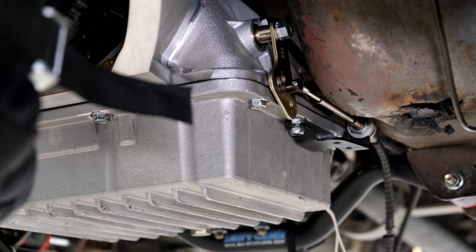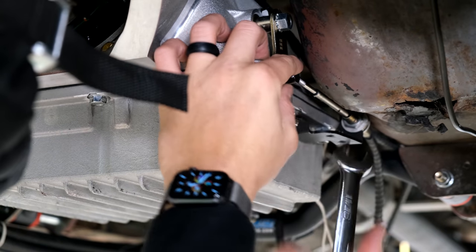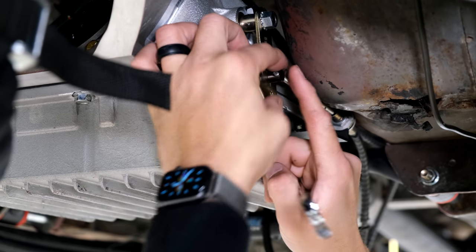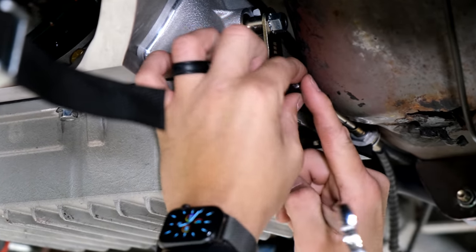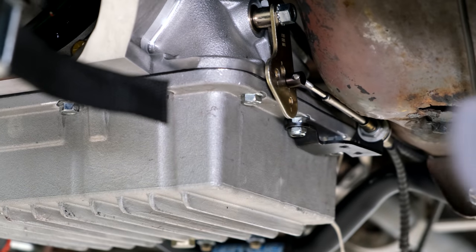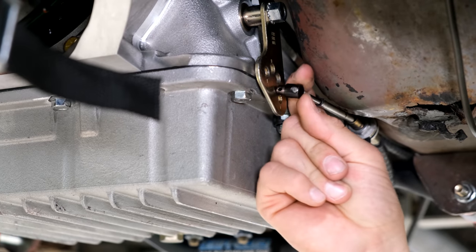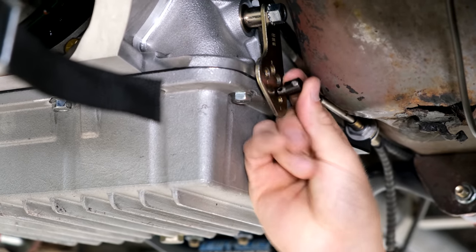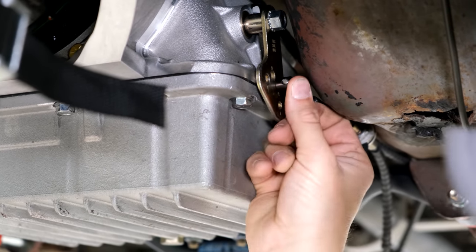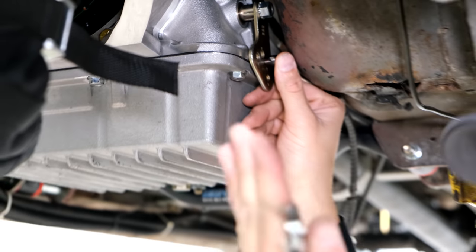That one was actually a little tight. Sometimes this angle right here, if you have the bracket bent, can cause issues too. But you can see it goes in and out of it nice and easy — that was without adjusting. If you need to adjust it, pull it out and rotate it clockwise or counterclockwise intuitively to make it shorter or longer. You'll be able to see where it falls in relation to the hole when you pull it out — if it's wedged, it'll either be forward or back to the hole.